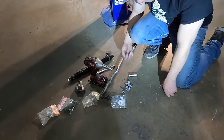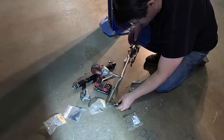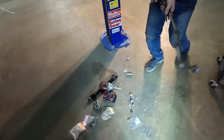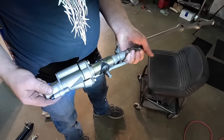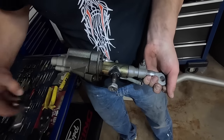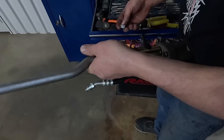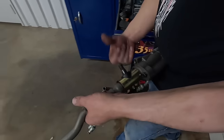The hardware is new to mount the drag link, but the drag link Jason restored. New ones are available, but it costs less to rebuild the old one and we still have the FOMOCO stampings and the originality. The threads are a little boogered on it — this attaches to the gearbox via the pitman arm bolt and we've got to put a tap on it, a half-inch 20. That ball turns, so you've got to have the threads perfect. There we go — it got bumped, probably on disassembly. We're back. Something like that can shut you down.